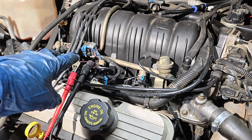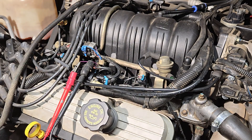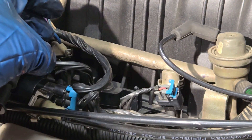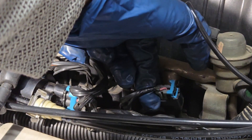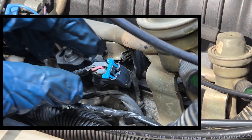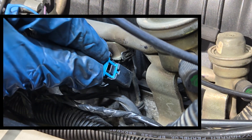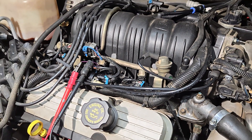These connectors are easily accessible, and so are the ones on the back for cylinders 2, 4, and 6. To disconnect the injector connector, you see that blue tab? Pull up on it, and then you see that black tab in the middle? Press on it until it clicks and then it comes out. Over here to the left on cylinder 3, we're already set up.